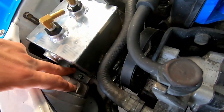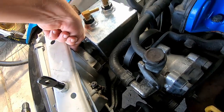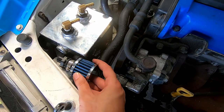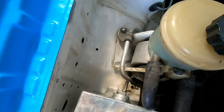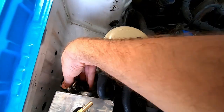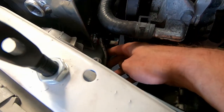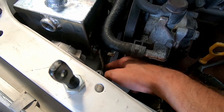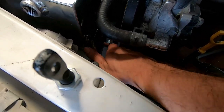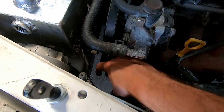She's in — I've drilled a couple of holes and on this side we put a spacer just to lift that up a bit. The reason being is I trimmed back the little cooling fins on the headlight since we're not really going to be using the headlight. And I should be able to 3D print another one of these adapters but with a right angle — I'll be able to fit one of the vents just there, super easy. Then the other side I'll do the same thing with the right angle, and the other one will sit just here where our cooling reservoir goes. Down here — it's a bit hard to see — but these hoses go down to the cooling pipes for the power steering. I've just got a little rubber piece on there just to stop it rubbing. And then we've got our tap, so the tap turns on and off easily to drain the catch can.